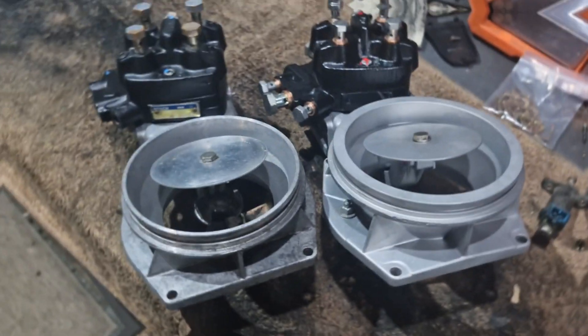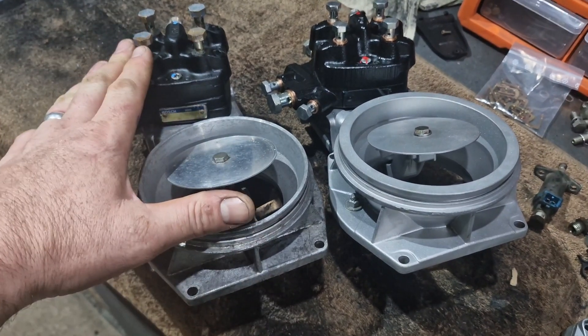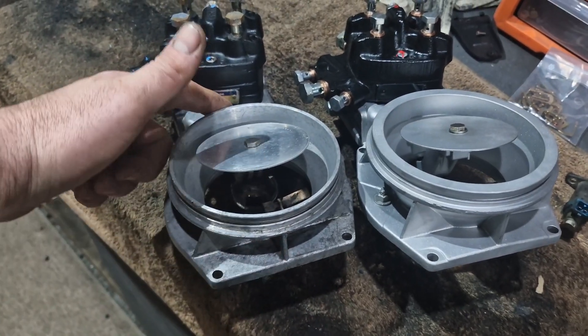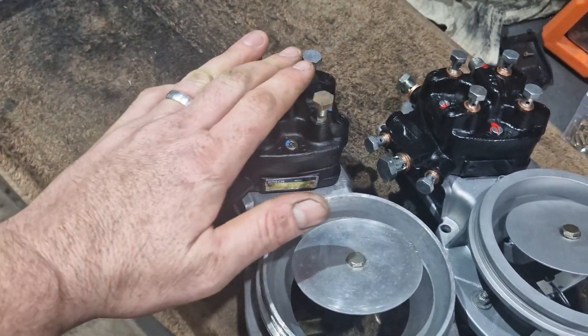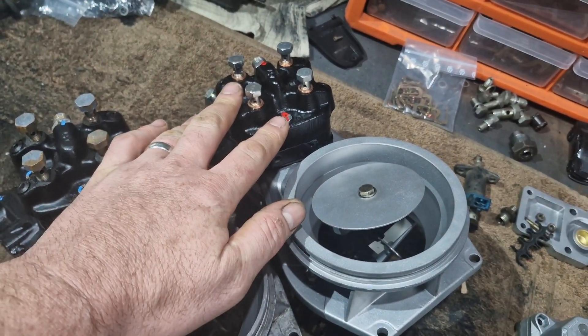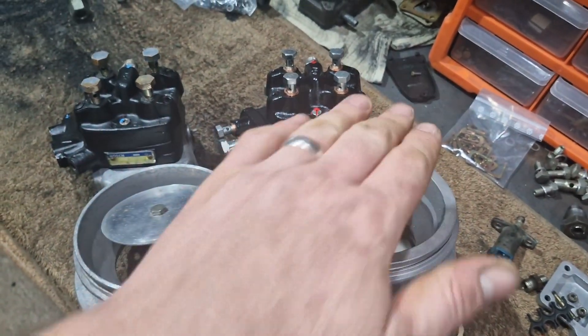The main benefit is that the air plate goes above the body. That clearly goes above the body. I'll get another one exactly the same as these two on a bench and show you the difference between a stock 16 valve and a Porsche one. Here we are with two units. This is exactly the same unit as what's on my car currently — this is going on a friend's car, same air meter, same modifications to the CO hole to stop it bottoming out and topping out. This metering head was originally balanced the same as mine: 180cc a minute, versus a stock 16 valve metering head.